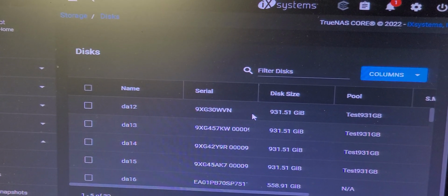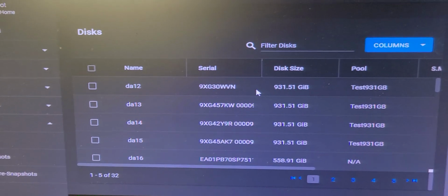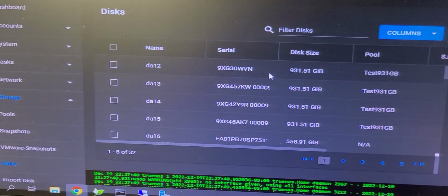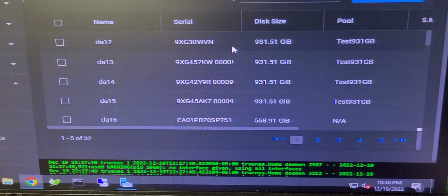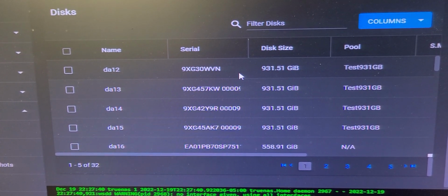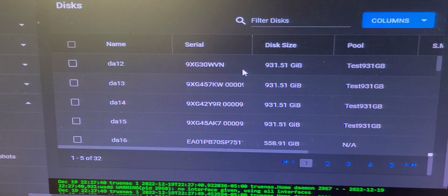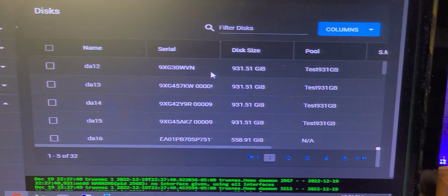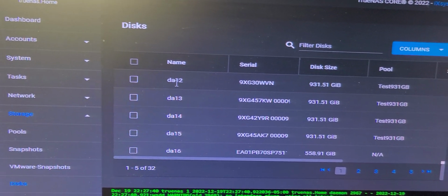And this is very common. Your HBA controller interface will test and stress disks using SMART mode and SMART communication. If you don't have it enabled on the platform itself, then you are going to set yourself up for a point of failure, and you don't want to do that. What you want to do is let these things run, let them find the drives bad, and then you can tag them to remove them out of your system. And I'll go over that in just a minute.